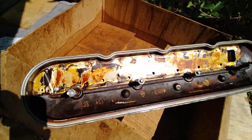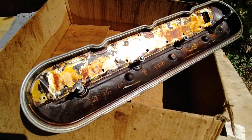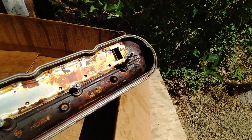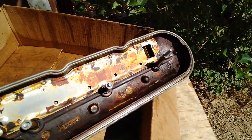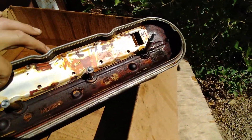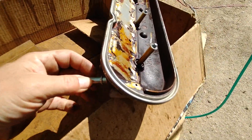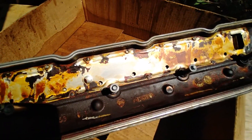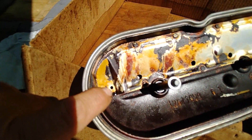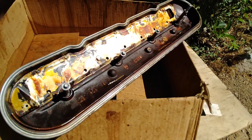Charles at Craze Performance Repair suggested this modification: adding holes — one, two, three, four, five, six, seven holes. You've got eight cylinders so you don't really need much over here. What happens is push rod oil shoots up through here, gets stuck behind this shield. The shield is to allow air for the breather valve for vacuum from the engine, and the only way that oil gets back down into the engine is through this port right here — this little bitty hole.